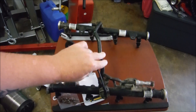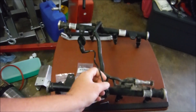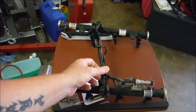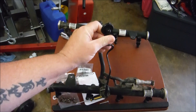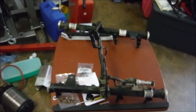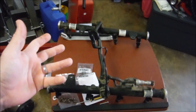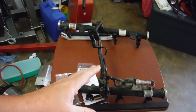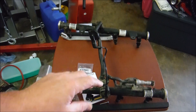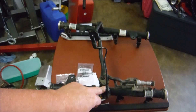On return style systems like this, you are not going to have 58 PSI at idle, and here's why. It has a vacuum-referenced fuel pressure regulator. When vacuum is pulling on it, it brings your fuel pressure down at idle — I've seen it as low as 42 PSI and as high as around 50. You are not going to have 58 pounds of fuel pressure at idle with a return style system. If you do, then something's wrong — your fuel pressure regulator is not doing what it's supposed to, or you've got a vacuum leak.